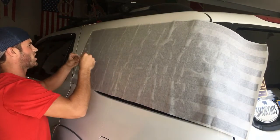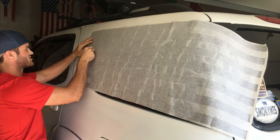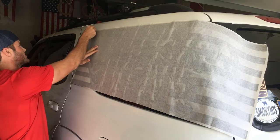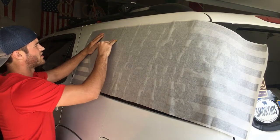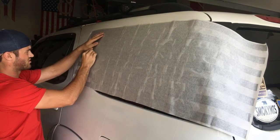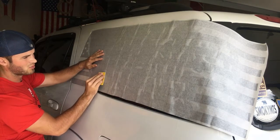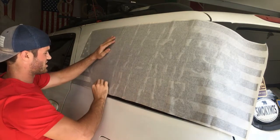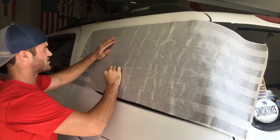This is just, you're working out the water inside of it and under all those bars. Now this is when it starts to stick. This is how you get it to stick. You want to work from the inside out and just push all that water that you put in there to help you move it. You want to push all that water out. This is what helps your sticker stick. This also gets out the air bubbles. We don't want air bubbles. You're just going to keep working that. You see down here how all that water's falling out? That's what we want.